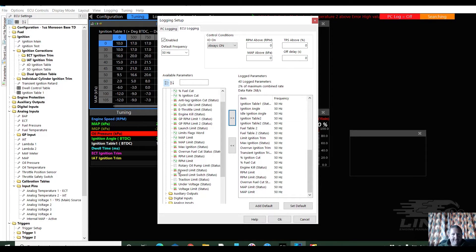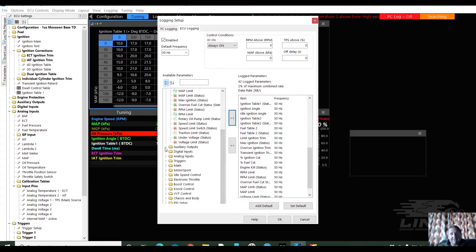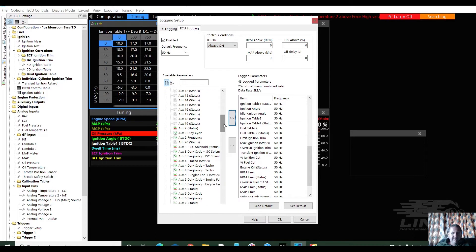Map limit — yes. I don't think there's a speed limit. Under voltage limit and voltage limit status — I wish I'd had this going the other day. I was doing some logging and it saved me a lot of time on diagnosis, having the logging there with those. I was watching it as it was doing it. Fuel pump status. Things like knowing if the fan's on — stuff like that can be really helpful when you're trying to solve problems on the engines.